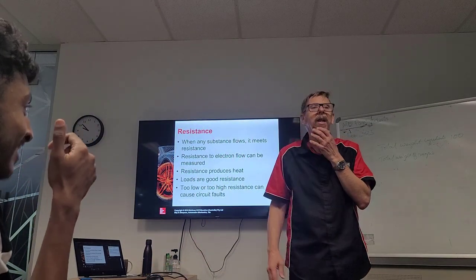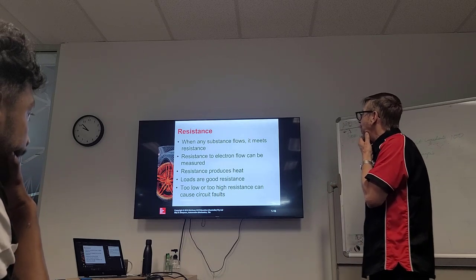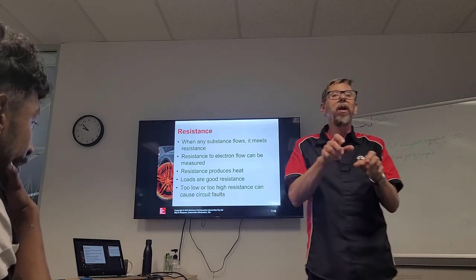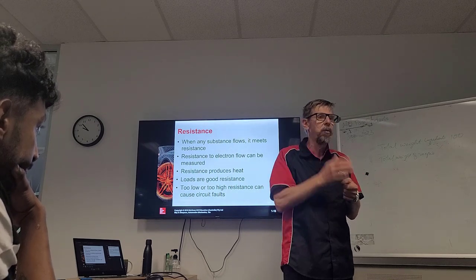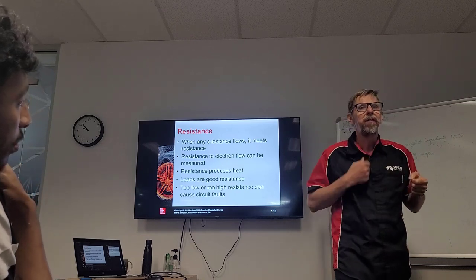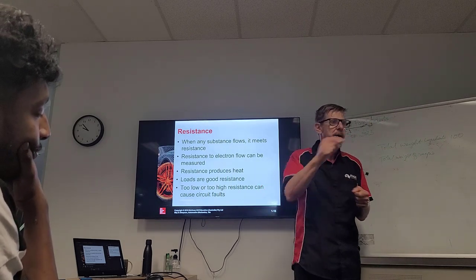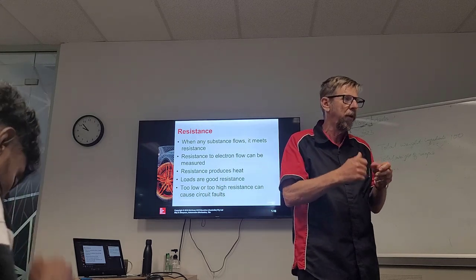All right, let's talk about resistance again. When a substance flows, it meets resistance. That's the same with our garden hose. If we put a nozzle on a garden hose, we can screw that nozzle down to cause a resistance, so the water doesn't flow as much. Or we can open it up and it flows a lot. Well, it's no different to electricity. If we don't have any resistance in the copper wire, it's going to flow very quickly. If we put a resistance in the wire, like our garden hose, we can slow it down.